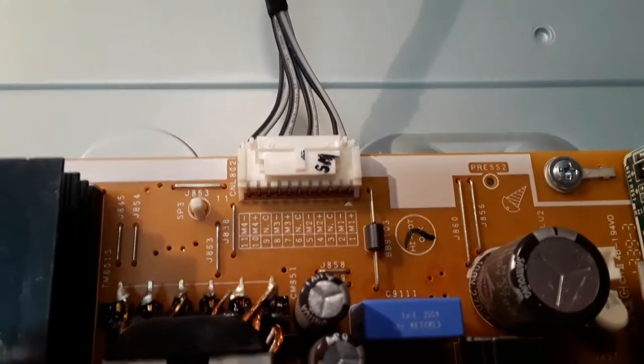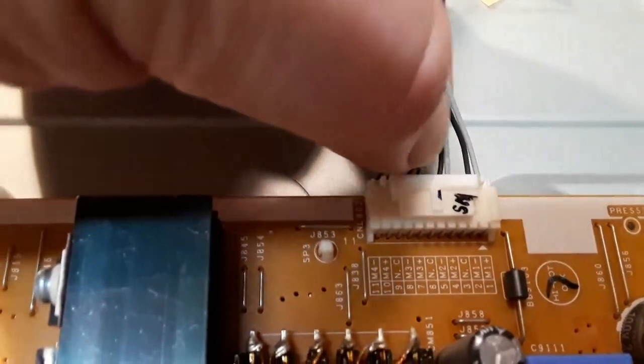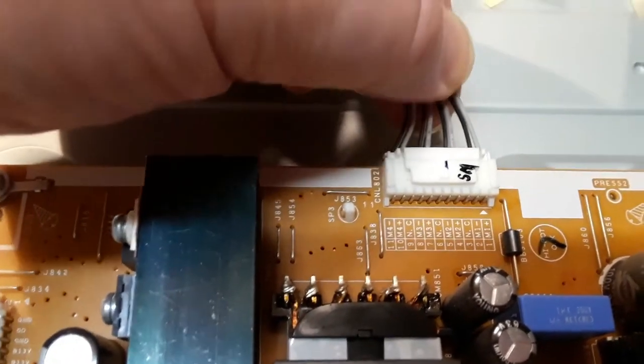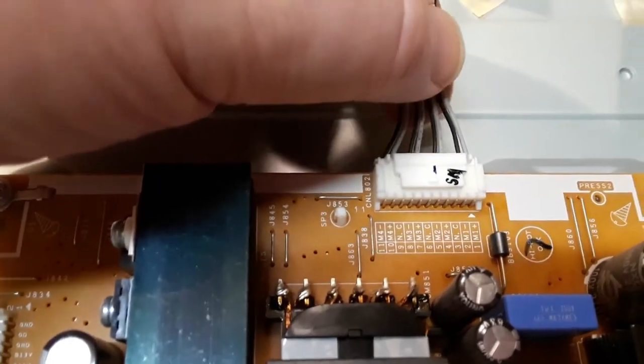A very dark picture usually means LED backlight issues. I'm going to plumb for backlighting issues — looks like there's a complete bar out. This is where the LEDs get their power from, and it looks like there are four independent bars of LEDs providing the backlighting. I'm going to test each one of these strips with an LED backlight tester to see what's going on.